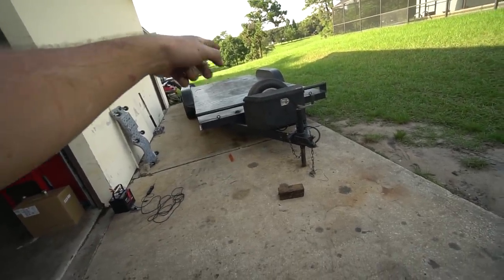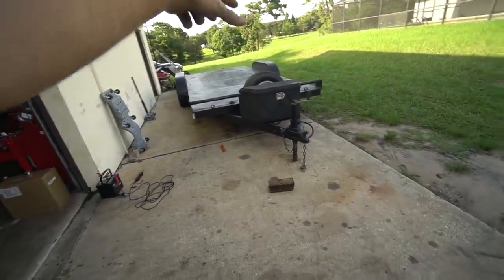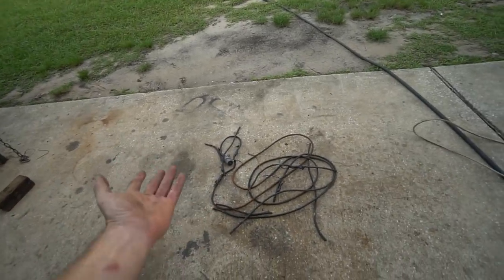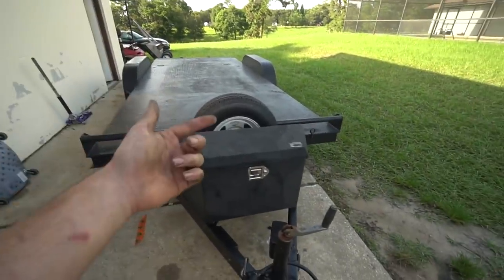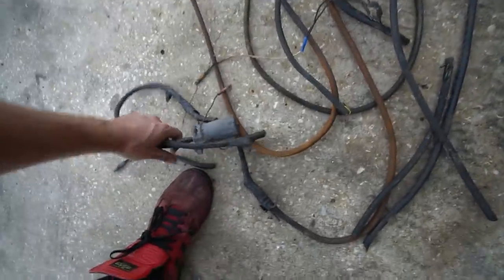I didn't get power to the light, so I had a short somewhere between there and there, but it's all encased and housed all the way down, so how are you gonna find it? You can't. So the individual wire way is not as clean, but I think it's going to be a lot easier to diagnose and fix any issues. So, anyway, let's get it hooked up. Let's do it, and throw this junk away. This harness is trashed.